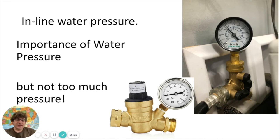Living in the city, I have pretty good water pressure at 70 PSI, and what I found is that when I was carbonating, I actually needed to use a pressure regulator to lower the pressure to around 40–50 PSI. At 70 PSI, I was having problems with the pressure of the water and the pressure of the carbonator getting out of sync — they were fighting for pressure from the CO2. What eventually worked was lowering the water pressure to 50 PSI, so the higher CO2 pressure was able to mix correctly.